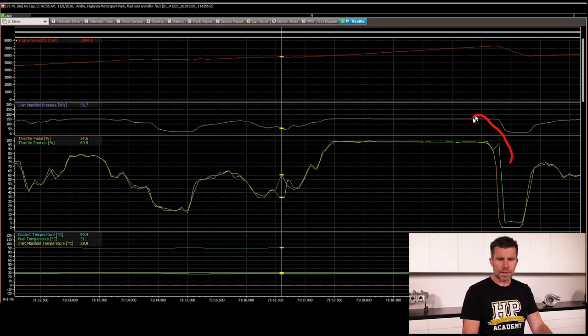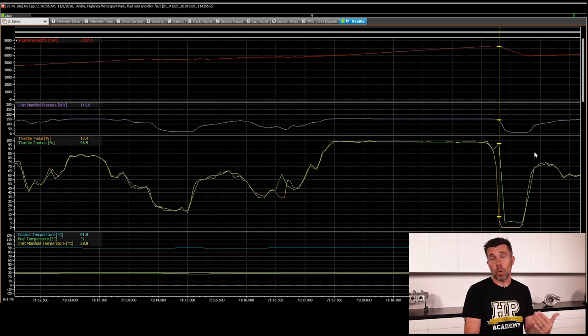Also, at this point where I actually get off the throttle, we can see the green trace jumps up and at its peak sits at about 96% — where I'm almost completely off the throttle pedal. This is worrying but probably insufficient for the driver to actually feel that problem. We also need to understand that the ECU has a tolerance it will allow in terms of variation between target throttle and measured throttle position, and how long that variance is allowed to be maintained. At this point we're probably getting pretty close to the limits but it hasn't been enough to trigger a fault.